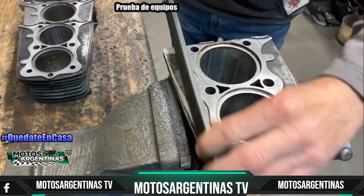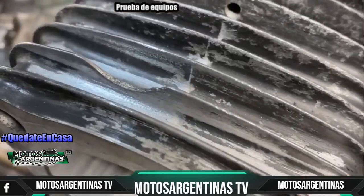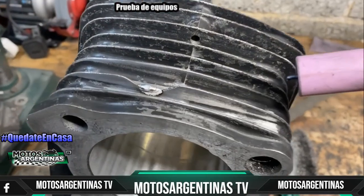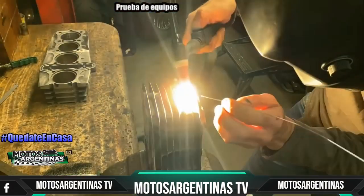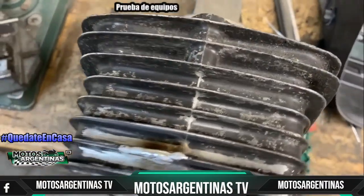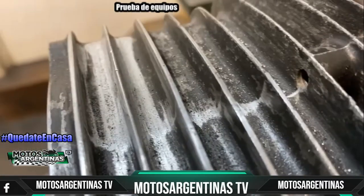With the top surface complete, I now concentrate on that broken fin from earlier on. So the first thing you do is use a stainless steel wire brush and give it a good rub to remove any oxidation and paint and bits of mess. Then with my TIG welder, you build up a weld starting at the bottom and gradually working your way up to the top, not worrying about how big it is because you can always file it down. Well, here's the finished weld where the fin was broken, and here's the fin once it's been filed.